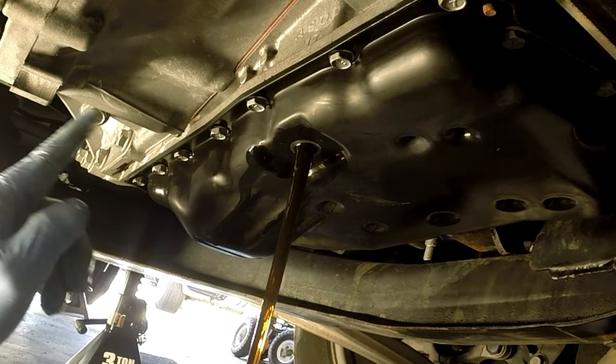I cleaned these magnets off and wiped all the oil out of the pan, then used some brake cleaner on this gasket surface. I want this to be free of oil. Now I'm going to put the magnets back — each one of these bumps helps keep them from migrating inside. In this particular pan we've got three magnets.